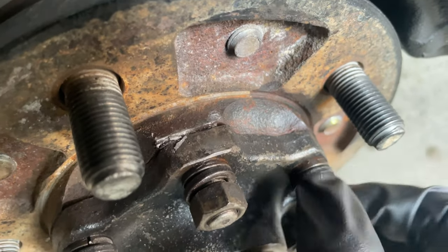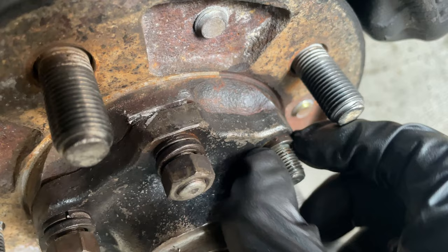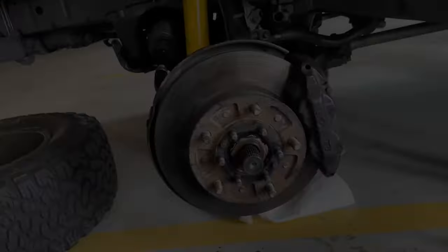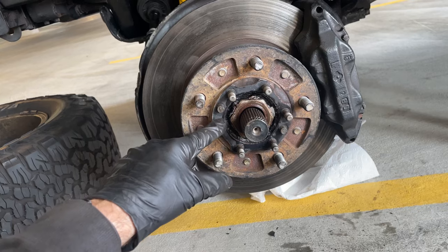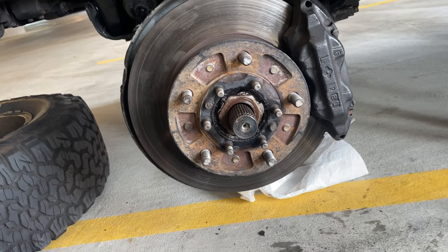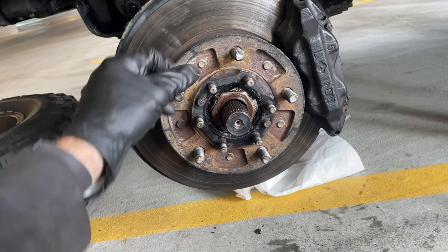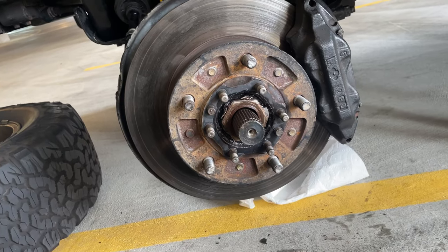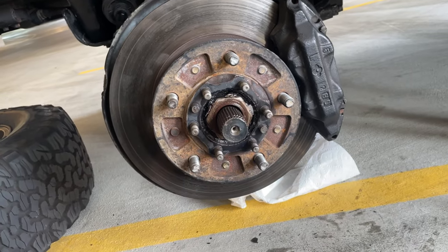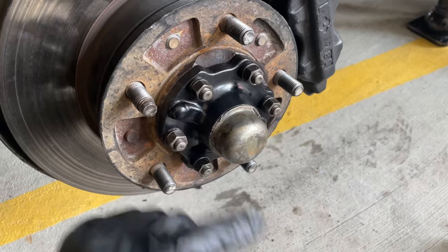Here's what it looks like when the cone washers start to come out. With the drive flange off, you can see the inner workings of the wheel bearing inside the hub. I'm going to replace the wheel bearings another time, but for now I'll take out the thin gasket between the hub and the drive flange and replace it — I'll include the part number in the description. Then I can slide the new drive flange on and torque each of these bolts down to 26 foot-pounds. Don't forget to put your snap ring and dust cap back on.